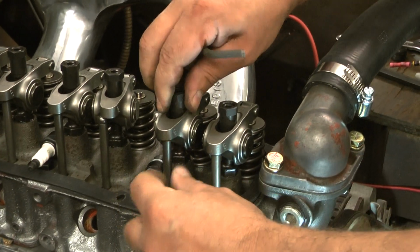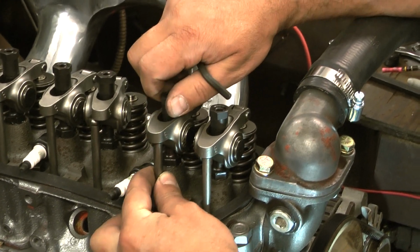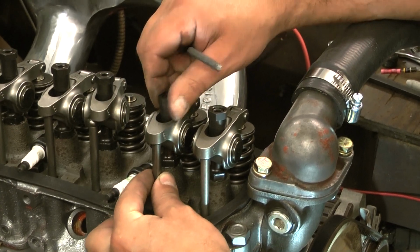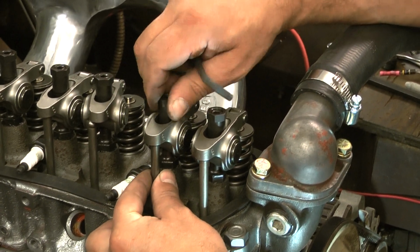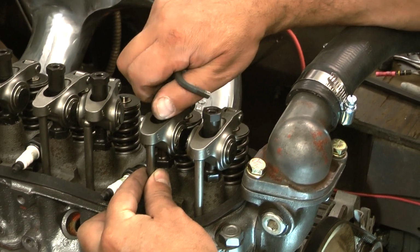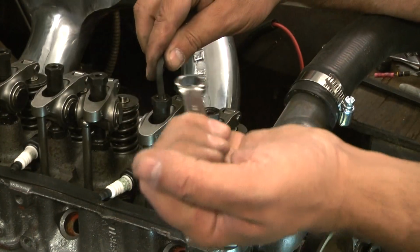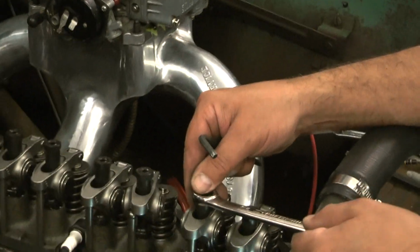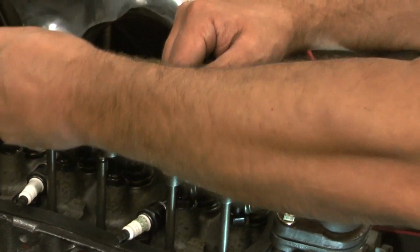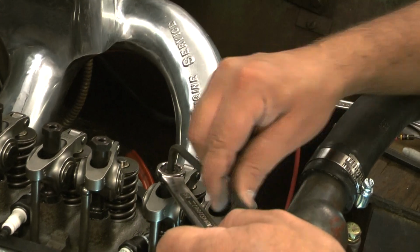Okay, I took it till it's loose. There, it's snug. When I say it's snug, it's like I can't wiggle it up and down anymore. You see it's gone. There I can wiggle it. There I can't wiggle it. So I'm going to hold it again. Turn it 1/2 a turn. And I'm going to hold it and then lock it.